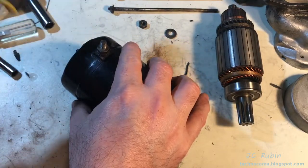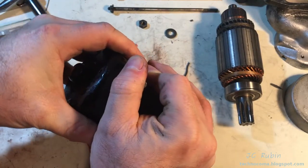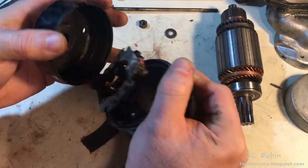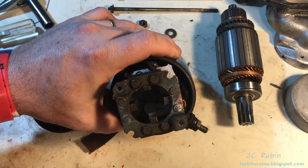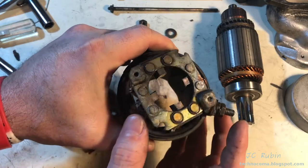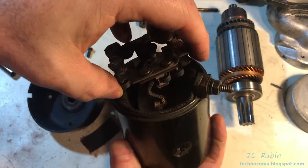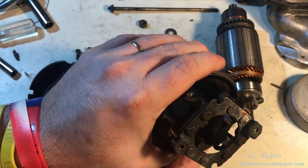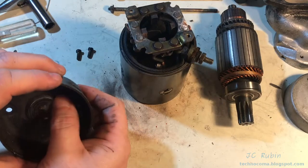I give it a couple of gentle taps around the insulator to loosen any loose paint, then holding the insulator in place I wiggle the cap back and forth to remove it. The brushes look dirty but definitely not worn out — no surprise since this starter didn't get a whole lot of use in the last decade. Everything needs to be cleaned up. I don't see any structural problems like broken parts or missing chunks in the end cap.